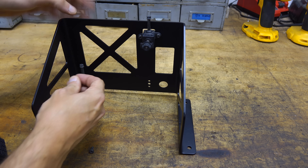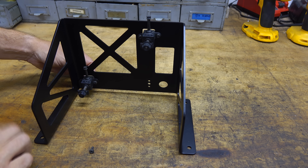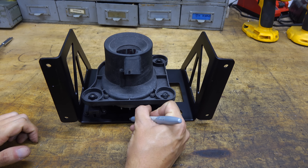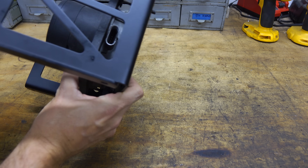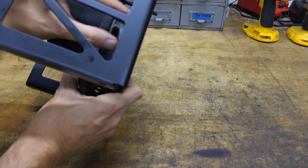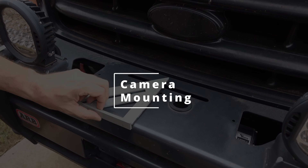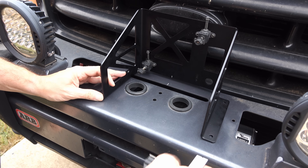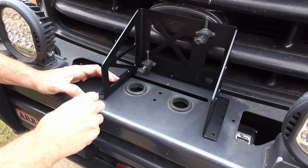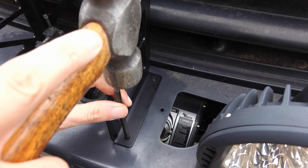Super simple. For the two adjusters that locate the camera and aim it, I actually reused the same screws that came from the original Cadillac mounting. With the camera temporarily in the mount, I'm going to go ahead and mark the center line of the camera — this doesn't have to be perfect, but I'm going to try to get it close. The camera's not centered in the bracket because of the electrical connector on the end; I need to be able to get it in and out, so I left extra room on that side. Using a speed square, I marked the center line of the bumper, then lined up the mark on the bracket and used the square to give it a uniform distance from the front of the bumper rearward so it just looks centered. Using a transfer punch, I marked the hole location.